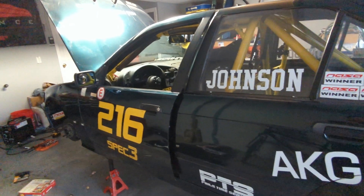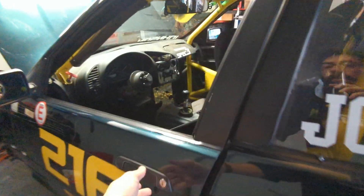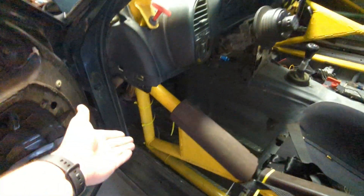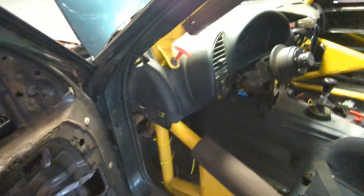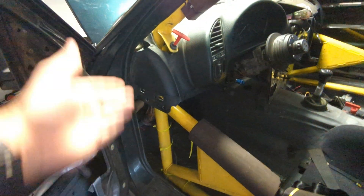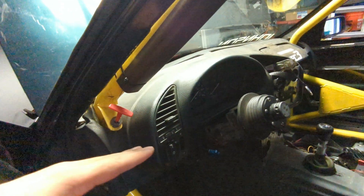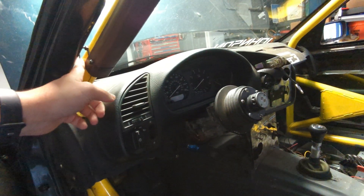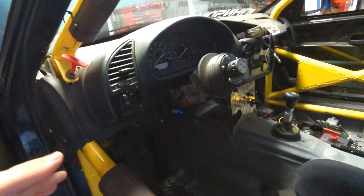There are basic requirements such as where the mounts touch. The front of the cage needs to meet the ground or the floor of the car on a plinth — a rectangular box welded to the floor — or a flat plate, which we'll show you in a second on the rear. The A-pillar bars need to meet near the front of the car. Optionally, there can be a dash bar across the front that connects the two A-pillar bars; this is not required for NASA but it's a good idea.